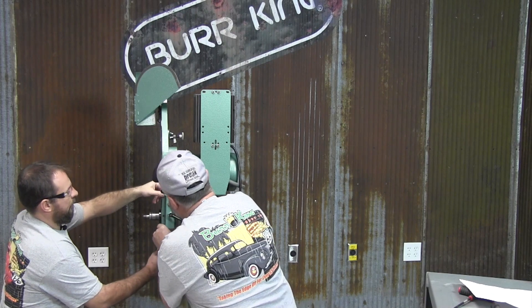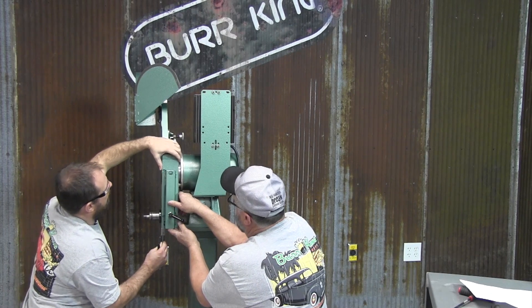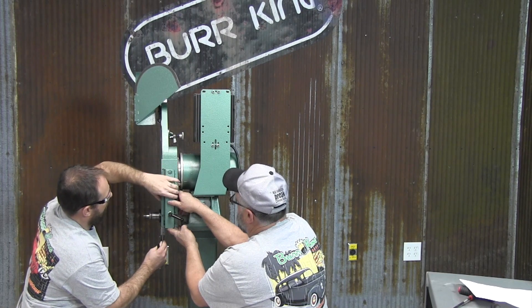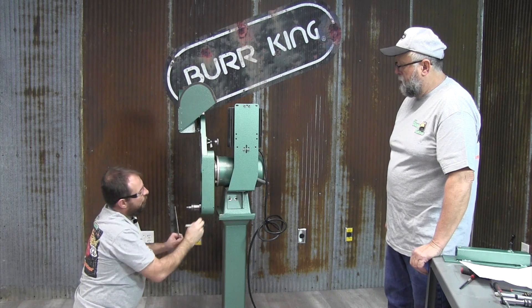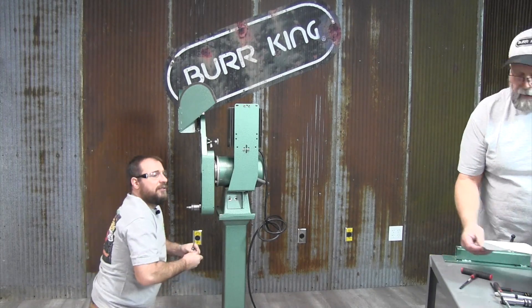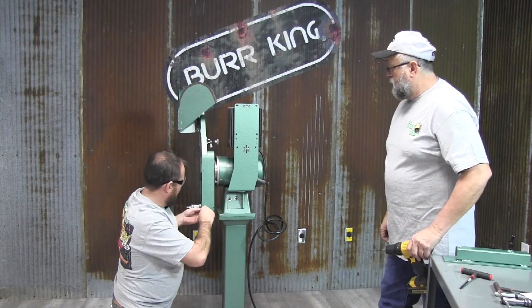Once you start to place the bracket into place, you want it so that the bottom side of the bracket is going to be flush with the end of the frame. That's what we're using the square for, and then we're going to line it up so it's even with the side of the frame. Once we get it lined up, you want to hold it in place. With a Sharpie and having everything lined up, you can see where we've marked our three spots. In these locations, we're going to have to drill a couple of holes and tap those holes out. We're going to use a punch to give us a starting point.